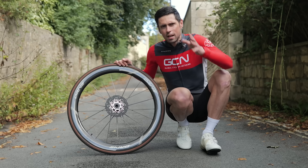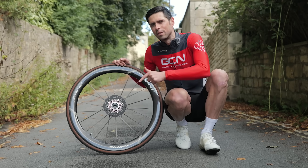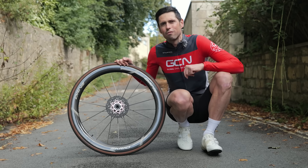Before I try riding down this steep descent, I need to answer a couple of important questions: what actually are carbon brakes and what are their relative advantages and disadvantages? To help me answer that, I spoke to Formula One brake expert Alex Robertson, who works for the McLaren Racing Team. Carbon brakes are a different way of doing a braking system compared to a normal road car or bike. Conventional cars and bikes with disc brakes use a steel disc and a pad made from some kind of organic or sintered material in a resin bonded onto a metal backing plate. They're pretty cheap, pretty reliable, they work well when cold and have good wear resistance, but they're very heavy and don't have very good performance at high temperatures.